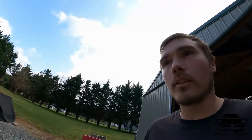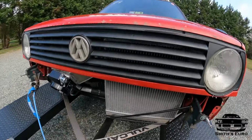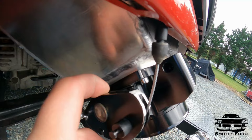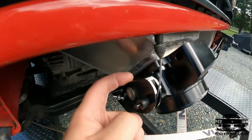In the last clip, you guys would have seen that the throttle body deleted itself again. So I just wanted to show you in the closing of this video that I did get another one. What keeps happening is that this adjustment screw or locking screw had a point, and the point rounded itself off because the screw is still in there totally tight, but there's no more point. So it wore itself off and then it was able to slide and slide.